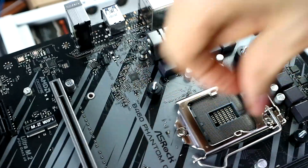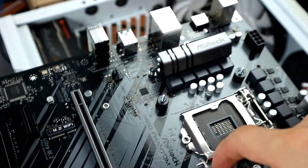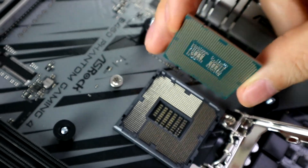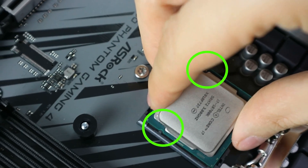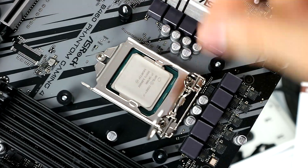To proceed, the CPU needs to be installed on the motherboard. If you haven't yet, remove the socket protector, known as the PNP cap. Loosen the lever, insert the CPU in the correct direction — double and triple check the correct direction — and tighten the lever again.